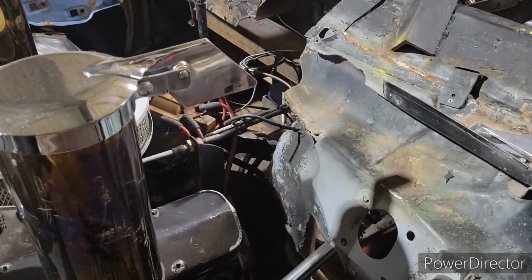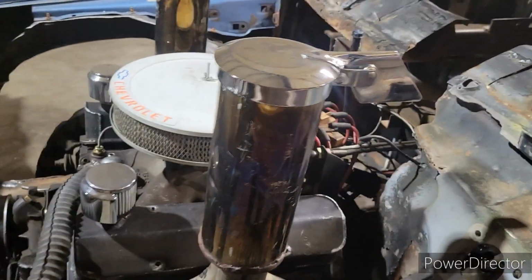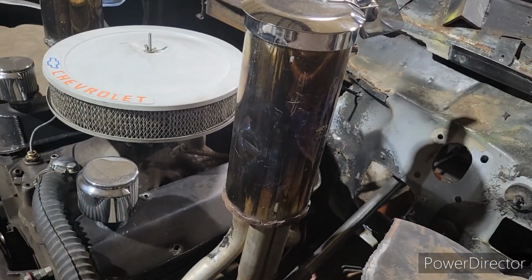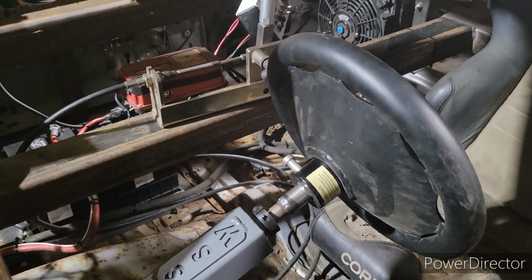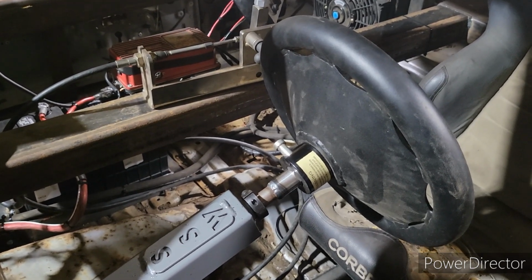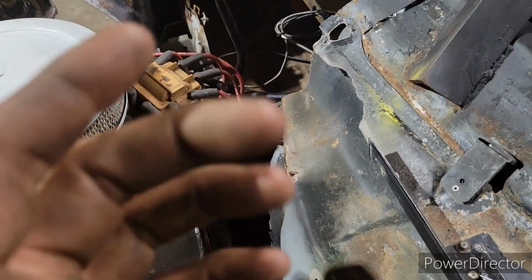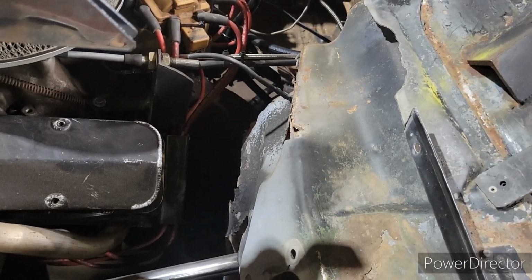He's in first gear. It's a Turbo 375. First gear, he's ripping around on it, and he backs up fine. Rips on it forward again. It safety shifts that time, and then he goes to put it in reverse. Lost reverse. So every gear, first, second, third, neutral, reverse is all drive, and then it still has park though, so it can't be anything mechanically. Well, obviously it's something mechanically, but it can't be anything to do with that shifter bracket, the detents and all that stuff, I don't think. But I don't know what's wrong with it, so we're going to pull that out.